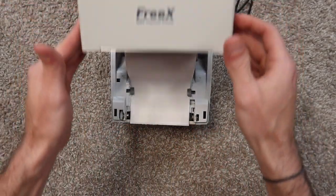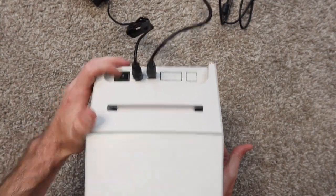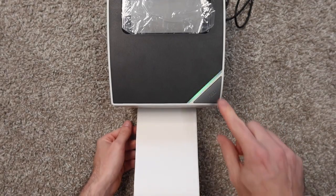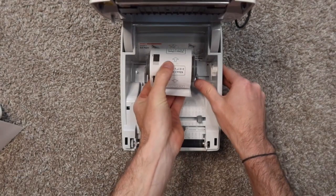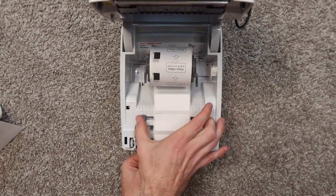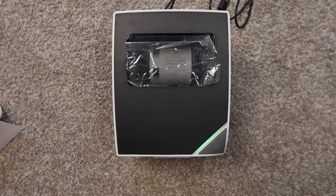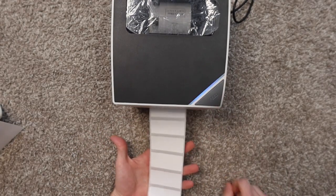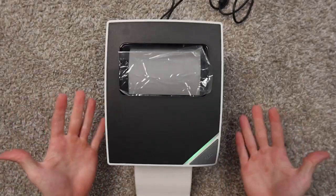Pull your roll all the way to the platen roller and close the top of your printer. Reach into the back, flip the switch from the circle to the line, and it should spit out one label. Press the feed button and it'll feed one blank label. If you ever want to change the label size, open it back up, remove the current labels, insert the roll you want with the print side facing the print head, adjust the guides, pull to the platen roller, and press it down. The printer auto-recognizes the label size and feeds one label. We're going to be using four by six rolls, so I'll put those back in — now we're going to install this on a Mac.